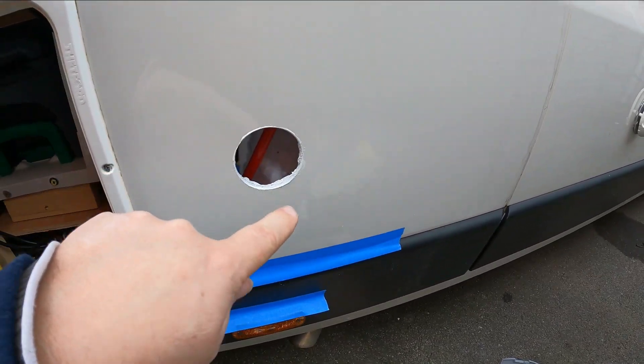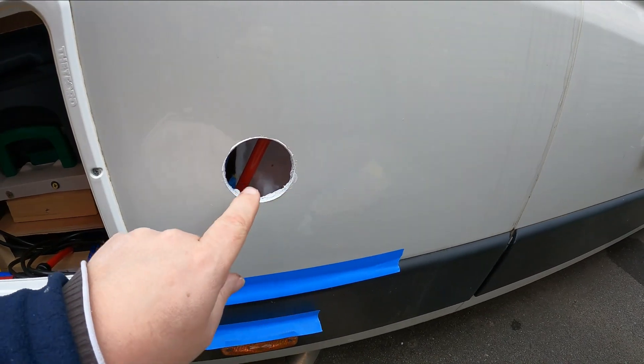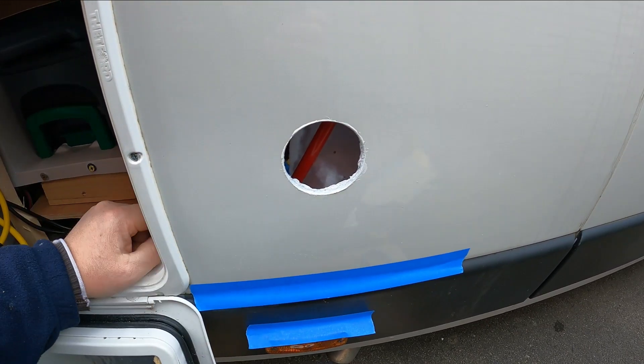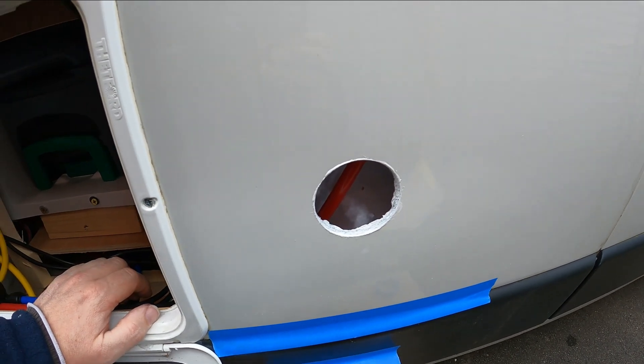Honestly, I'm such an idiot - I accidentally put the camera into time-lapse when a GoPro's only got one button. It's an age thing. Anyway, what you just saw in time-lapse was me using the file and filing around there - the tip being to leave the masking tape on while you're filing in case the file comes out and jabs the paintwork accidentally. I filed the hole and then used some Hammerite paint, painted around the hole, and that's just drying off nicely while I go and prepare the wooden frame for the inside. I'll try to remember not to put it into time-lapse again.